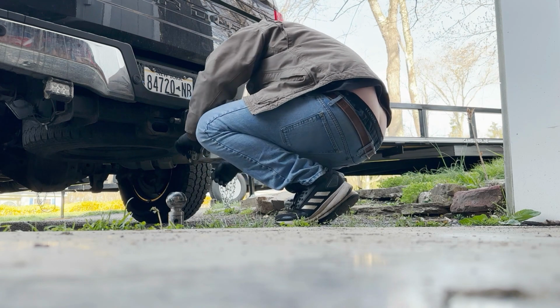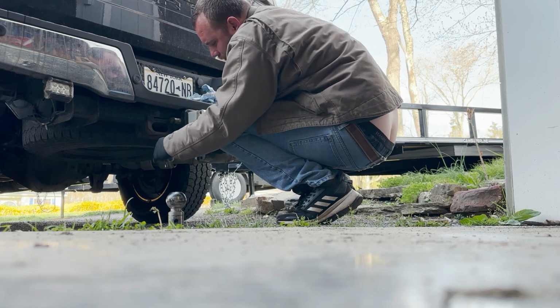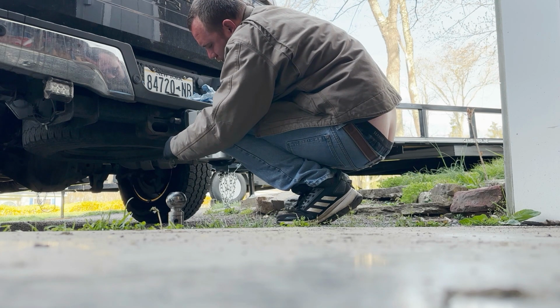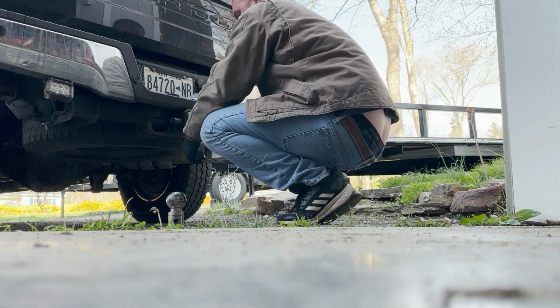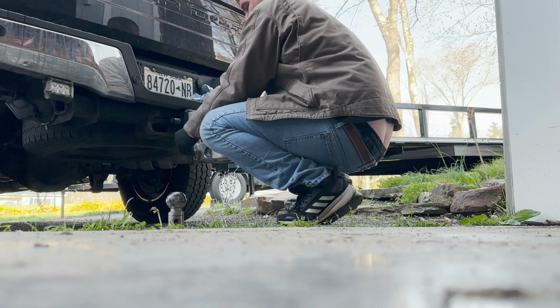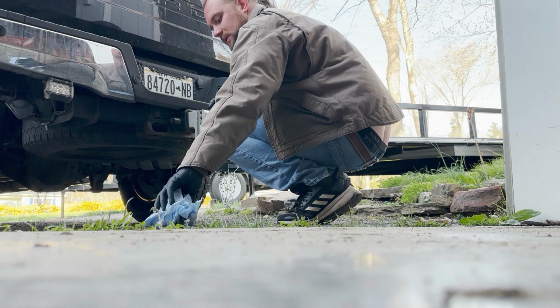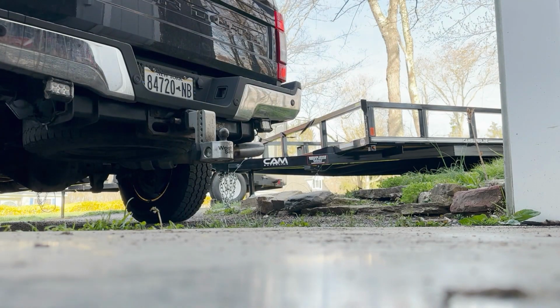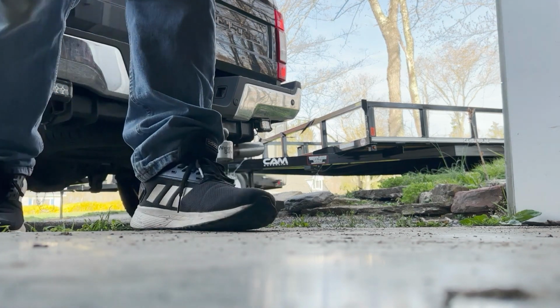Is going to go through. Is that through? Okay. Just making sure it's through both holes. All right. Do a little test, make sure it's good. Pop our cover back on. Then I take this, just because of all the grease on these balls. Okay. Put that in the toolbox. Gloves off, and don't forget the key. It is that simple on the weighsafe hitches, it is that simple to switch the balls out.